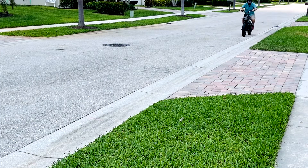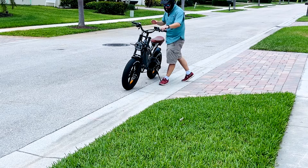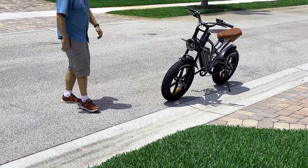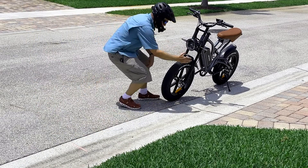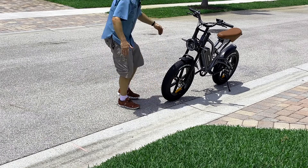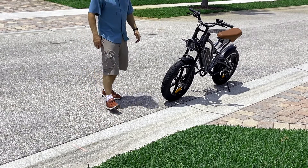I got to 20 miles an hour — wow! I could skid the rear tire, which I could not do with the mechanical brakes. I stopped at least seven feet or two meters shorter. This is where I stopped with the full mechanical brakes. If I were to upgrade the front brakes to hydraulics and go to 180 millimeters, I'm sure I could stop in a drastically reduced distance. I'm happy with the results just in the back, so I'll probably go ahead and upgrade the front.